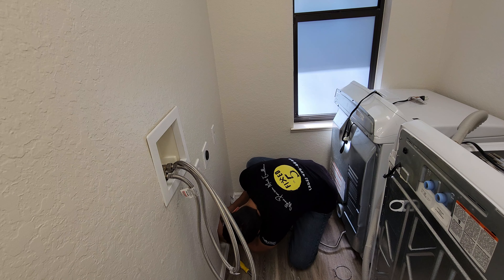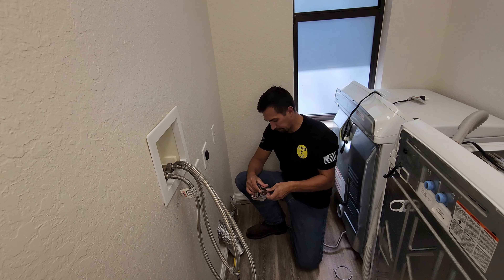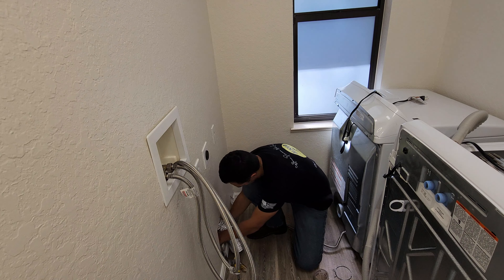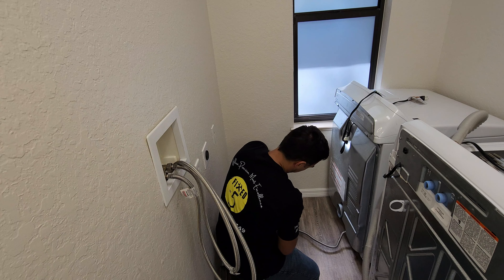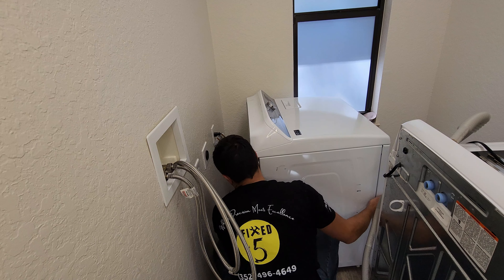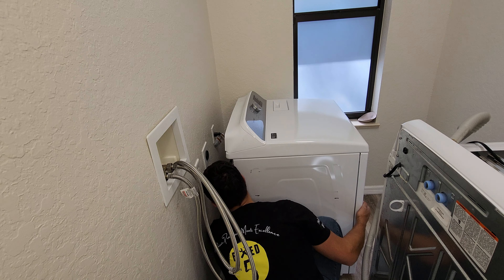Now that the dryer has been officially cleaned and all the lint is gone, we have to put the flexible duct dryer hose back on — simply attach it to the wall outlet and then attach it to the dryer. When pushing the dryer back, be careful not to kink the hose. Put the accordion section back together and position it where it's not going to be damaged, or you'll be doing this project all over again in six months cleaning up more lint.